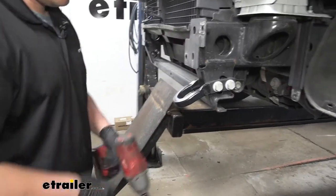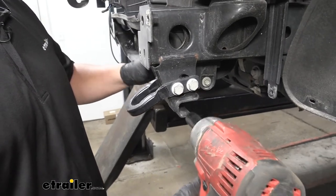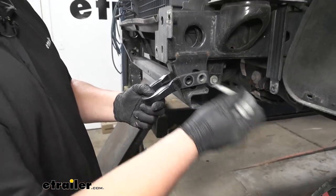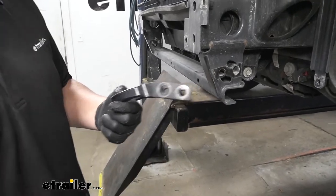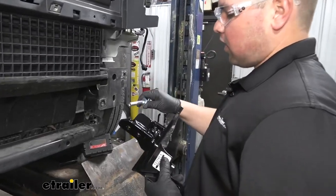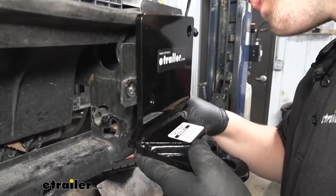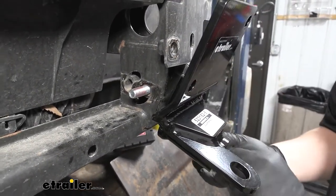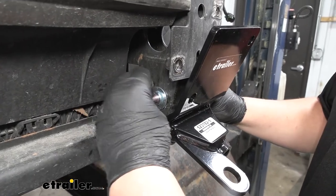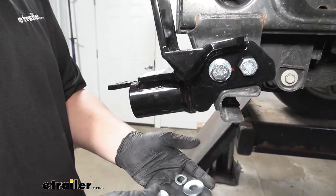Now to pull off this foam covering, we can grab an 18 millimeter socket and just loosen up our tow hook. With the nuts off the backside, we hold our tow hook, slide our bolts out and remove the tow hook — the tow hooks will not be reinstalled. We will be adding red Loctite to all of our new hardware. Now we're going to grab our base plate and our hardware. Our forward most bolt is going to have a flat washer on the outside of the frame rail. Slide that through, and on the backside we're adding our big flat washer, split lock washer, and hex nut. For our rear hole we take our bolt, slide it through, and on the inside add the same flat washer, split lock washer, and hex nut.